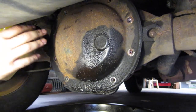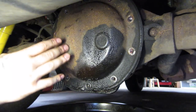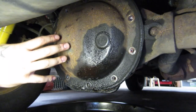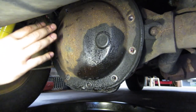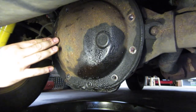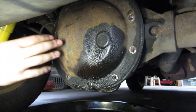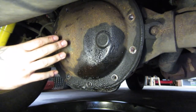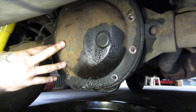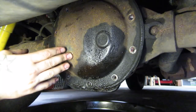This weekend I've got to do some towing with the Cherokee on the highway, so I want to change the fluid in my rear diff and my transfer case, and I'm going to do the front diff as well. What I've got here is the Chrysler 8 and a quarter. This process is going to be the same for just about any diff. If you're not sure about your oil capacity or what type of oil, you can look it up online. All Dana axles are going to do just fine with some 80-90 gear oil. If you have a limited slip, you need to get the right gear oil with the limited slip additive.